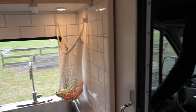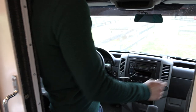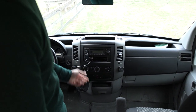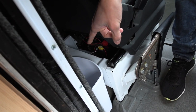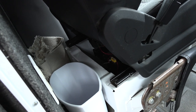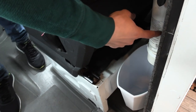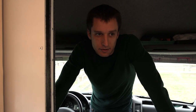Let's take a look up in the cab. Not much has changed since our last video — we still have a pretty standard cockpit setup. I added a Bluetooth receiver for those long trips; it's nice to have some tunes. We also added a trash bin and recycling bin up front. I wired a standard 120-volt household outlet to our inverter and put it on this bulkhead wall. Over on this side, I added a K-Class fire extinguisher since it's going to be close to our kitchen. A K-Class is designed for household fires, specifically grease fires — it'll work well enough on a diesel fire too.